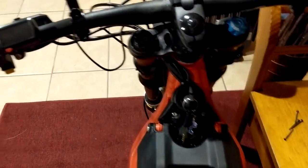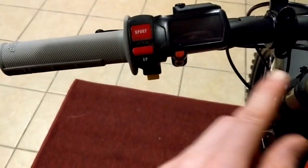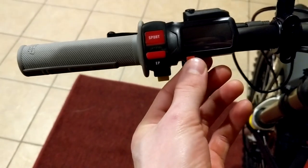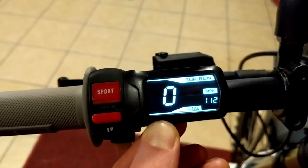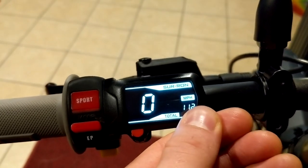Alright, so right now my surround's off. I'm going to come over to the speedometer — the little red button on the bottom of the screen. You're going to hold that, and then we're going to turn the key on. So it's on. Keep your finger on there for three seconds, and it is now miles per hour.